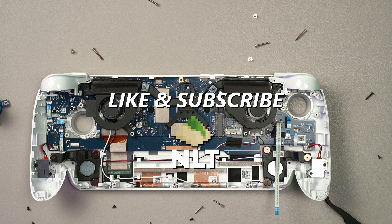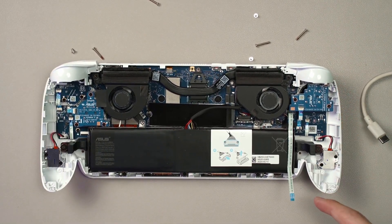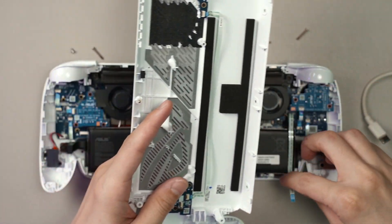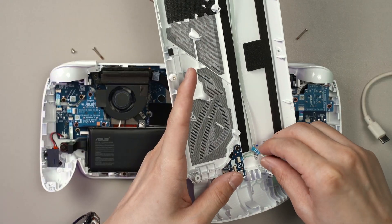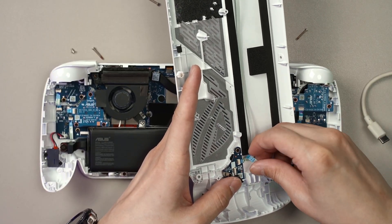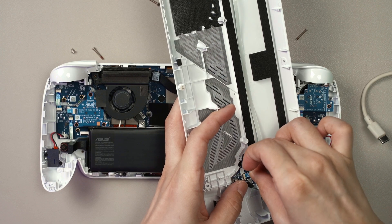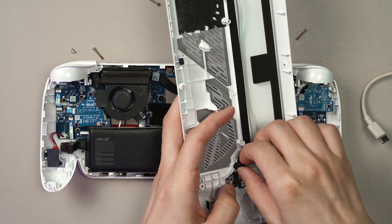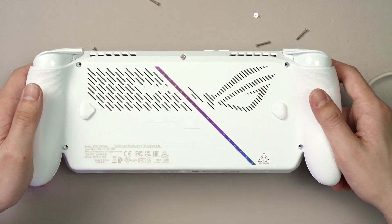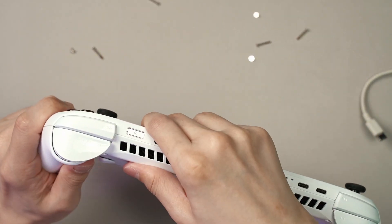I will just put back everything together and show you how this light sensor works. I got the reassembly back to this stage. Let me just reconnect everything — you have to be a bit more careful because the way this cable goes in, you don't have much slack to maneuver. You have to do it real close to the main board. Once you've got it in, lock it in. When you close it, just remember to press it around the grips, the cable, the top, and the bottom.